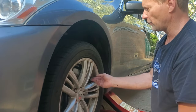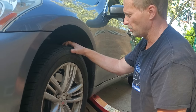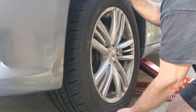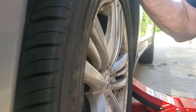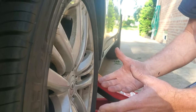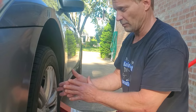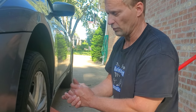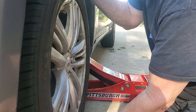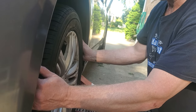We checked everything else in the back and it all seems pretty good. So I've gone ahead and ordered a wheel hub bearing for this and we're going to go ahead and replace it, and hopefully that will solve our problem. So again: 12 and 6 is for a wheel hub bearing and a ball joint; 9 and 3 is for a wheel hub bearing and tie rod. Since it's moving on both, that could tell you the wheel hub, tie rod, and ball joint could all be bad — but we already checked the tie rod and the ball joint on the control arm looks good, no play in there. So yeah, we can hear that — it's definitely a bad wheel hub bearing, and we're going to go ahead and replace that. Hopefully that takes care of this issue.